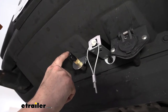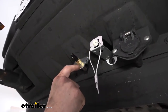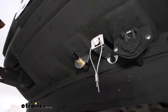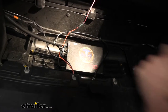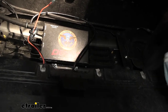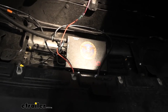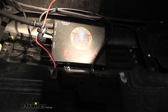We put this right into the plastic using the included hardware - held it up, used a paint stick to make marks for the holes, used a quarter-inch drill bit to drill two holes in the plastic shield, and slid the hardware through. The hardware is a bolt followed by a fender washer through all components, then a nylon locking nut to secure it in place. Just behind that bracket we drilled another hole in the middle between the two screws about an inch back, just for our airline to pass through the panel to plug into the fitting. Our next component is on the other side of the paneling - we're underneath now. We mounted the main operating unit by drilling two holes in the metal strip at the bottom and using quarter-inch fasteners with washers, lock washers, and nuts to secure it.